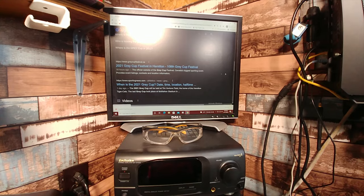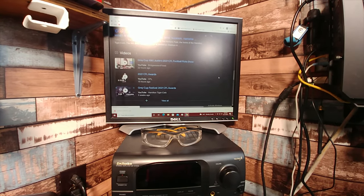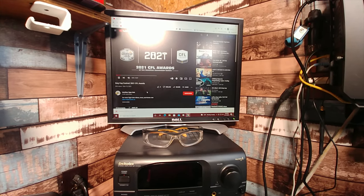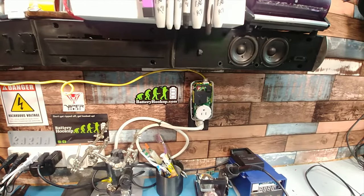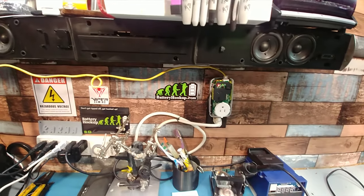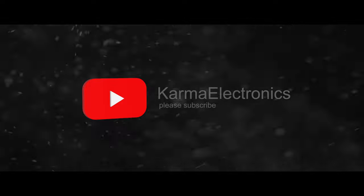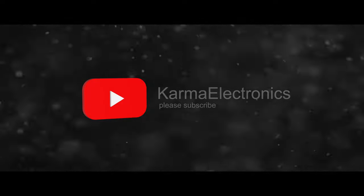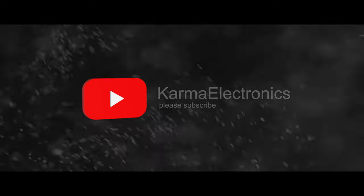It's actually pretty fast — I can see why they're worth $140 a piece. That is way better than doing it wirelessly. It's still better than the network card I have, so I'm going to leave it and set it up so I can use it full time. If you have any issues with them and you can't get the link up after holding that button for two seconds, more than likely the button's gone bad. I jumpered it for now and I'll probably swap the button out with another one before I put it back together. See you next time.